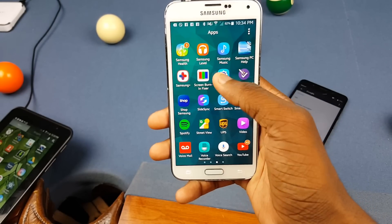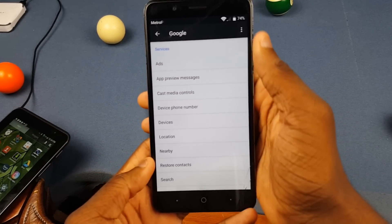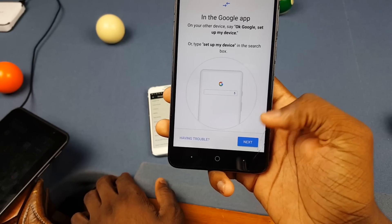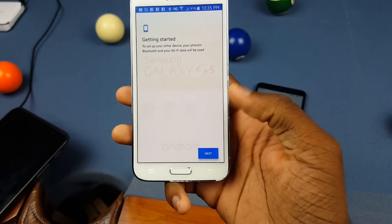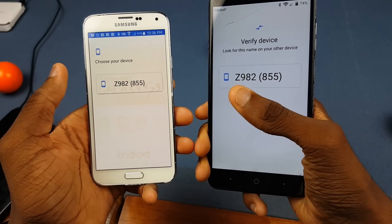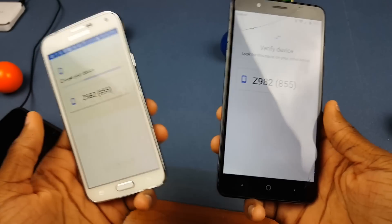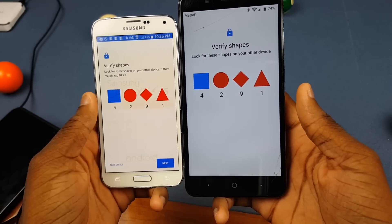If you have something newer, go to Settings, scroll down, and look for Google. Now go back to your ZTE phone, click the menu button, tap on Show Debug Items, then scroll all the way down and click on Smart Device Target Flow. Click Next twice. Then click Setup Nearby Device, tap Next, and it's gonna search for the other phone. This will connect the two phones together and transfer Google account information between them.